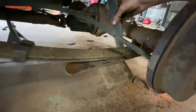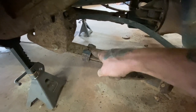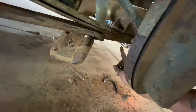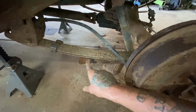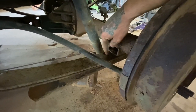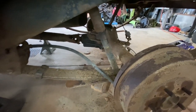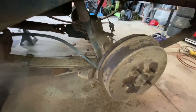Everything's loose. The spring pack is held together with these clamps — you can just get a pry bar and pry them apart. Get those clamps off there. And underneath, there is a bolt and nut that holds that whole pack together, so spin that off there, take the center leaf out, jack the diff up, put my block between the spring and the axle, put those longer U-bolts in, and that's pretty much it. I'll get this all torn apart and kind of get everything in place, and show you what we've got.